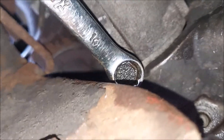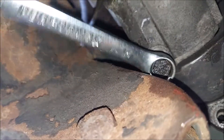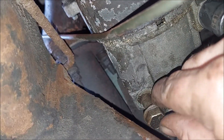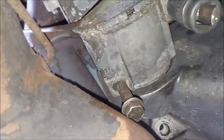Right now I'm just taking out the starter bolts. Almost got this one — there's just barely any room. Go slow and get this harder one out first, then you should be able to get a socket and extension on the other one. Even when you have the bolt all the way undone, you still can't get the bolt out. So when you install the starter, you have to get it up in there before you put it in — see how it's hitting? This setup is just the dumbest thing, but keep that in mind.